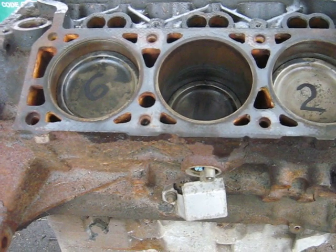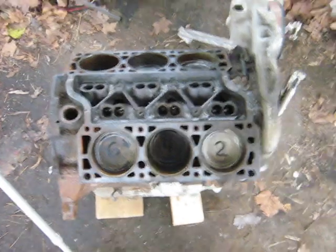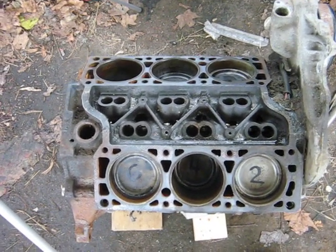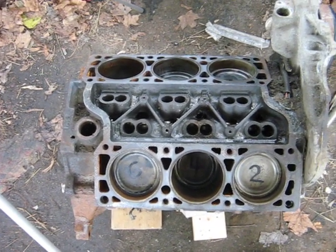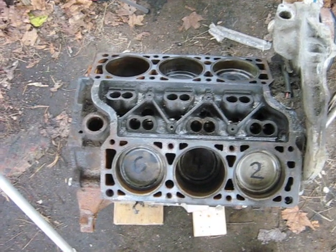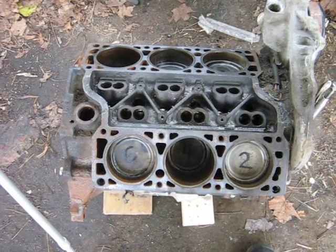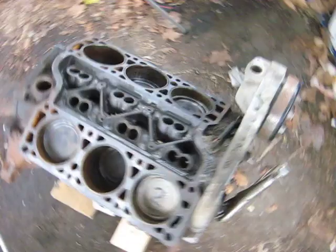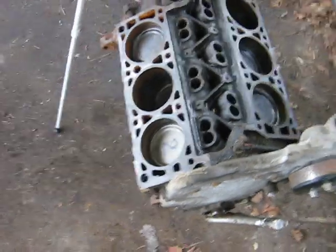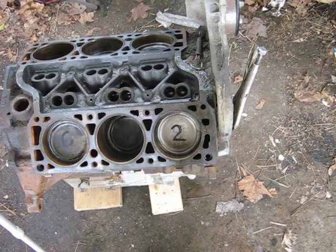It would actually somewhat simplify things. I can't guarantee that'll work. I was thinking of using a supercharger but using a carburetor on it instead of fuel injection. You also have to develop a way to fire the spark plugs, because a stock distributor isn't going to work quite right with nine cylinders to fire. I was actually thinking of just firing the front banks, so you'd have in effect six pistons firing.